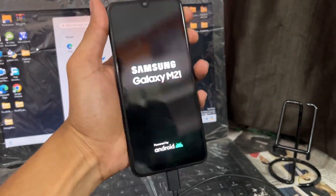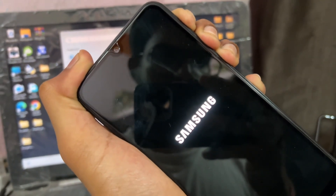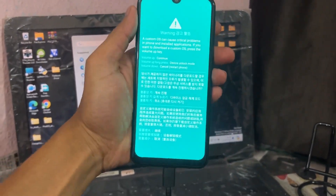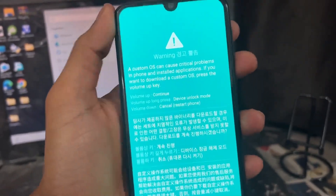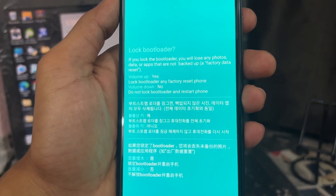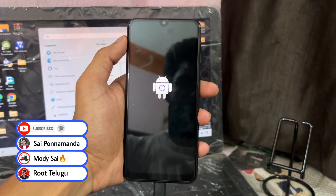I will show you how to do it. Press Volume Up and Volume Down — and in my case also the power key because I have my camera in the other hand, but you don't need to do that. Just turn off your device, press and hold Volume Up and Volume Down key, and attach the data cable. When it shows the warning screen, press and hold the Volume Up key for a few seconds. As we can see, the 'Lock Bootloader' text appears. After that, just once click the Volume Up key, and now your device is going to lock. Our device is now locked. This is the process for locking the bootloader.